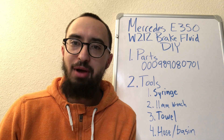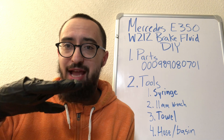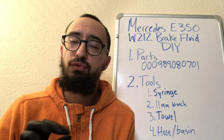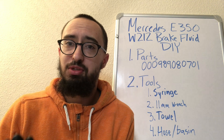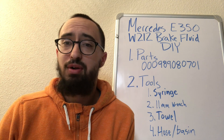After you're done, check that your brake fluid is at the max line. Replace the little screen and tighten your cap. Then start your car and, before you take it out of park, make sure you test the brakes a few times to confirm everything feels right.